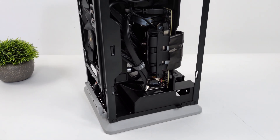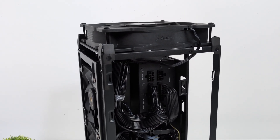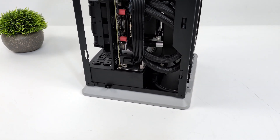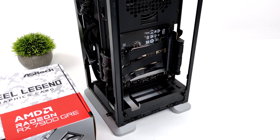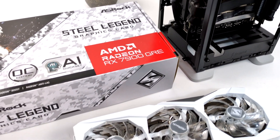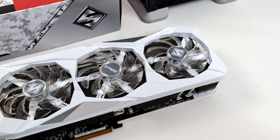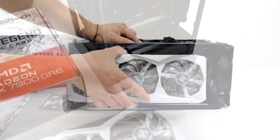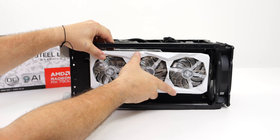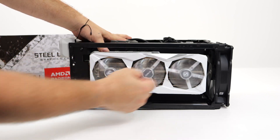After messing around with it for a little bit, I was able to make that 240mm AIO fit. I did have to swap those fans to the front so they're not rubbing on any cables — it's going to push air over that cooler into the case, and with that 180mm fan up top that comes included with the Mood, it's just going to pull all that air out. The Ryzen 7950X does have an iGPU built in, but we're not going to get any real good 1440p gaming on that. So I'm adding an AMD Radeon RX 7900GRE — this is the ASRock Steel Legend version. We've got 16 gigs of VRAM, and basically this is a cut-down 7900XTX. The GRE is going to be perfect for 1440p, and on newer stuff we can definitely go to 4K.